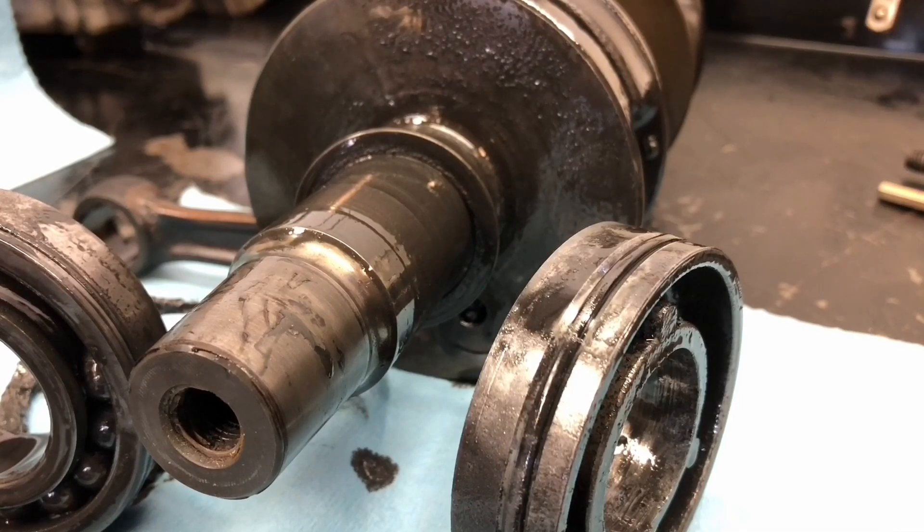This is not a result of anything crummy or inferior parts with the Rotax engine or anything like that — this is just from plain ordinary corrosion inside the engine. It sat for a long time and then it was run, and that corrosion circulates through the engine and just chews everything up. It's just like a grinding compound in there.